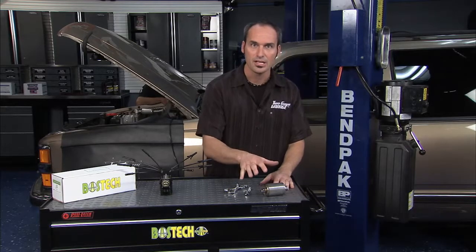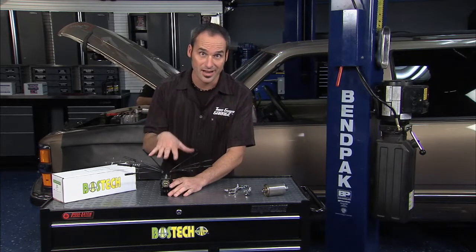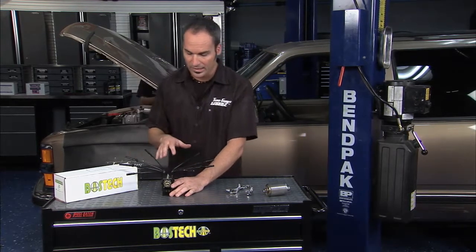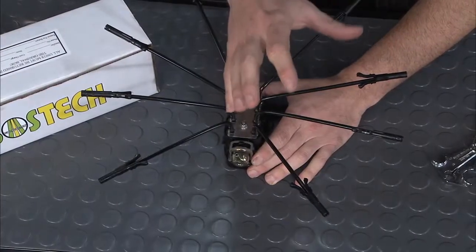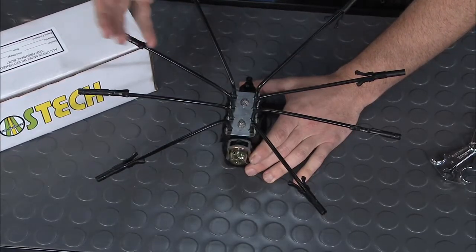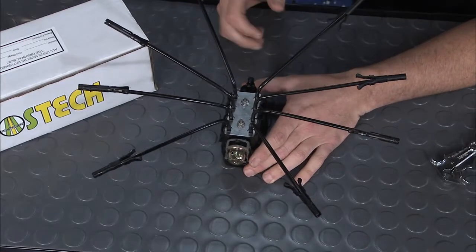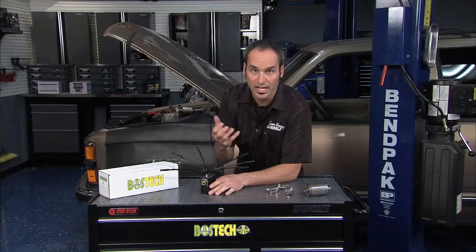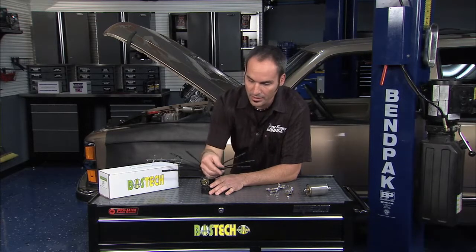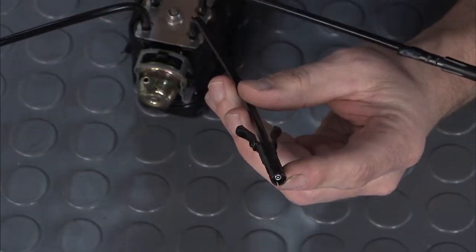What that does is it keeps all that debris and things from moving their way forward into some of the more high-dollar stuff like your injectors. Now this is a neat system on this vehicle — it kind of bridges the gap between throttle body injection and multi-port fuel injection with individual injectors up on the rail. This is what we've got on the truck here and it's somewhat called the Spyder — it's a central SFI system. If you look in here, there are tiny little orifices with little needles and seats, so you get debris in there and you're going to have some troubles.